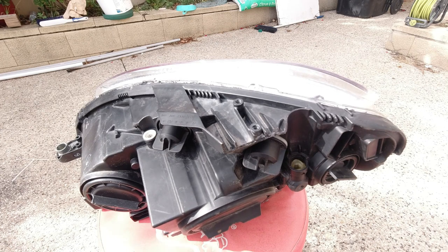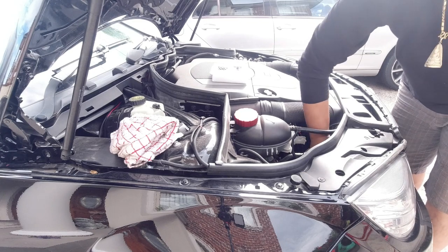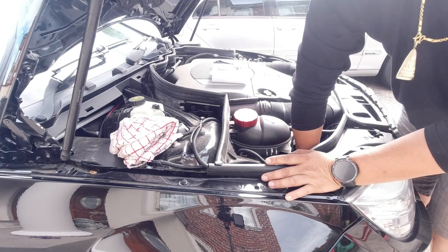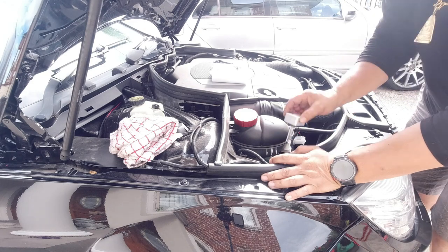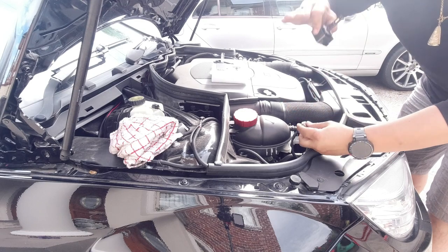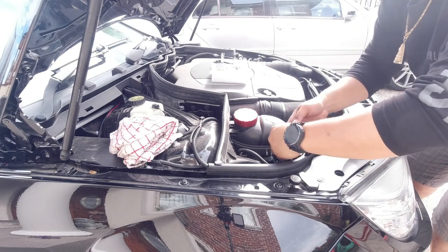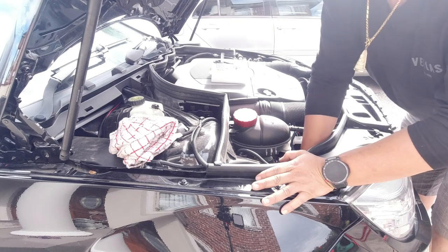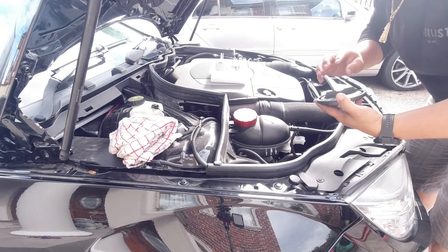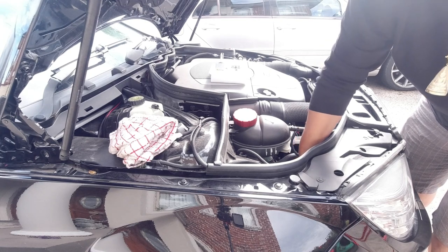That's how you install your headlight bulb in your W204. Now we'll just go over to the car and install it. I'm going to remove the headlight bulb cover, unplug it, undo the clips, and pull out our HID. The pins are on the lower portion of the connector — it only goes in one way, so you really can't get that wrong. Plug it in, put the clip back on, and replace the cover — push the wiring back in, put the cap on, and simply turn it clockwise.